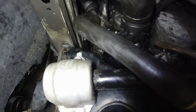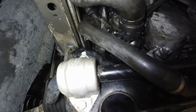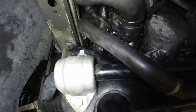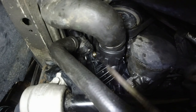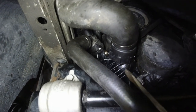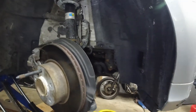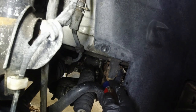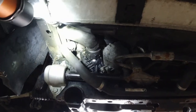Once you're refilled with coolant, warm it up, wait a bit. When the thermostat opens, the fans will kick in — that's when you know coolant is circulating — and then you check for leaks. This might take up to half an hour. I did finally take the wheel off to clamp down this hose here. As you can see, no leaks, still waiting for the thermostat to open, but so far so good.